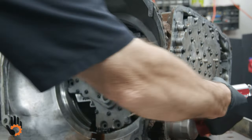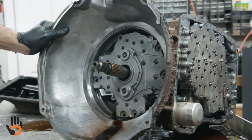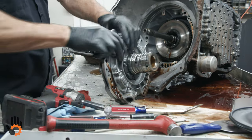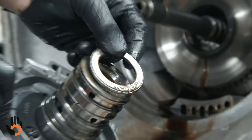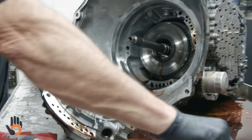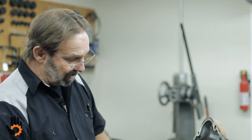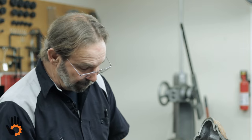The pump should just pull straight out the front — no need for a pump puller, it simply comes right out. There's a bearing from the back of the stator shaft that goes between that and the input drum. Chrysler on this unit uses like a dozen of these bearings — most are all about the same size and shape. They don't use much in the way of thrust washers, mainly thrust bearings, which makes it a heavier but stronger unit. We'll split the pump later.